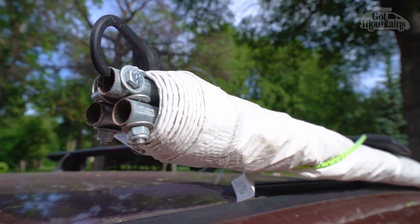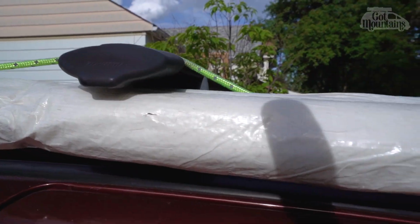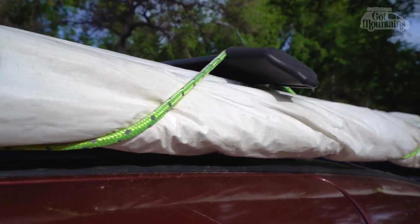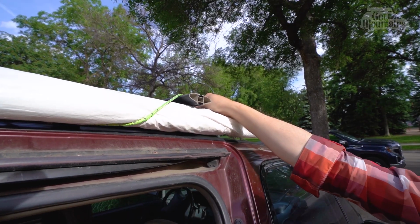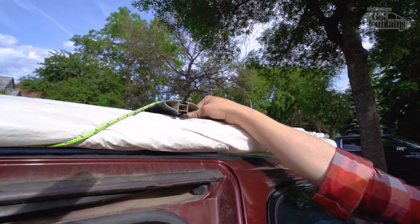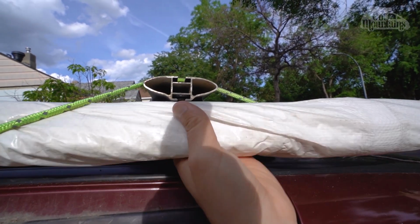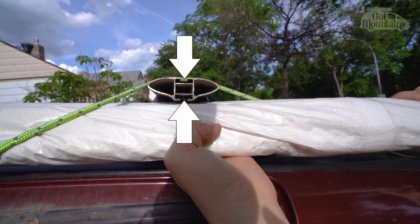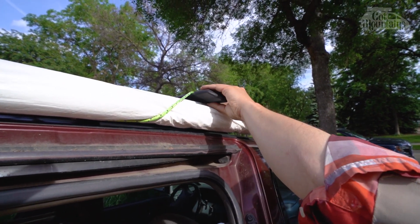To build this awning, you'll need to start with a tarp. We found a cheap 8x8 tarp, but would have preferred a smaller 4x8 tarp that didn't occupy as much space beside the van. Another challenge you'll have is determining how to attach it to your van. Most roof racks have a channel that will nicely receive a carriage bolt in the track on the top or the bottom of the rack. You can access that track by removing the plastic end caps.